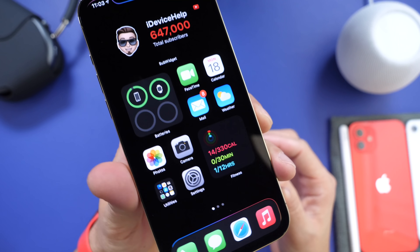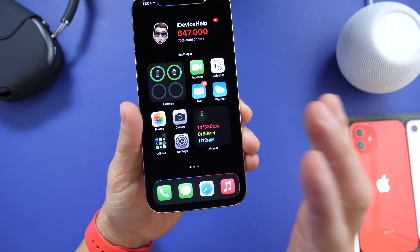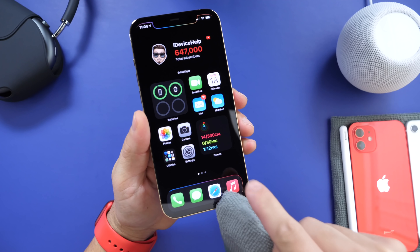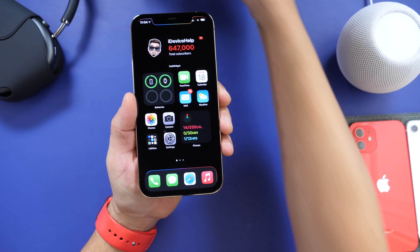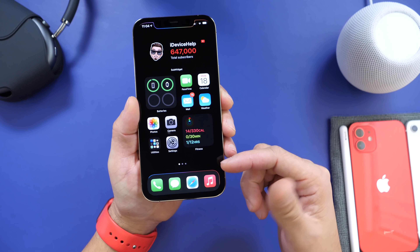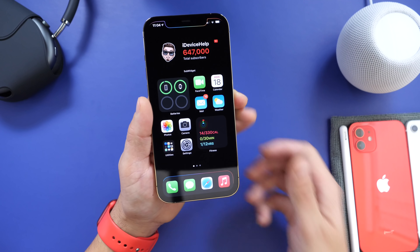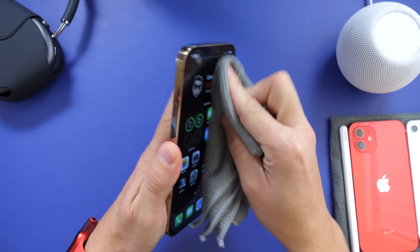Another very popular question is: how do I clean fingerprints from the display of my iPhone, the camera lens, and the frame? Honestly, the best thing to do is find a clean microfiber towel and just wipe them away. The iPhone has an oleophobic coating on the display, and if you use household cleaning products like glass cleaners, it will damage and potentially remove that coating. If you remove it, the smudges will be so bad you'll barely be able to see your screen. So never use glass cleaning products on your iPhone's display.